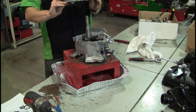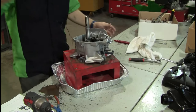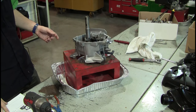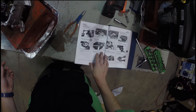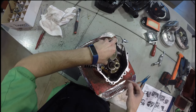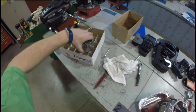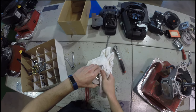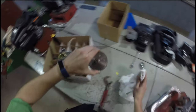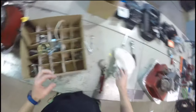I'm going to try to look for the best area so I don't crack the aluminum case. I like this little spot right here. I've got this wedge tool that I use quite often. Oh there it goes — sweet. This should carefully pop off. We've still got a lot of oil in there — Mr. K didn't do a good job at draining the oil. Remove the governor gear and shaft. The camshaft — this should just pop out, which it did. Excellent. I'm going to put this in here and wipe off a little bit of the oil. This is a camshaft — at this point in time we should know what the camshaft is.